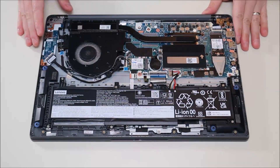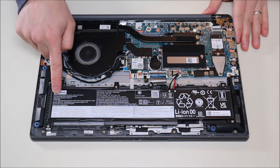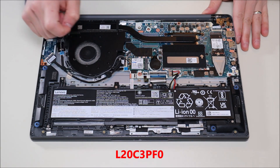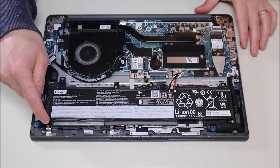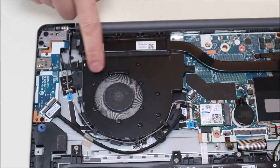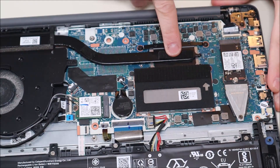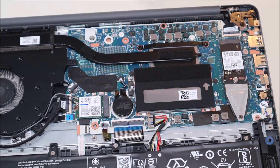So there's the inside of your computer. You have your battery that runs along the bottom. If you're looking to replace it, this is a Lenovo battery — the model number is L20C3PF0 — and it's got quite a lot of screws holding it in. This is your fan assembly connected to your heatsink assembly that runs along here to your CPU. The CPU is integrated into the motherboard — it's soldered on — which means it's not an easy component to take off and replace.